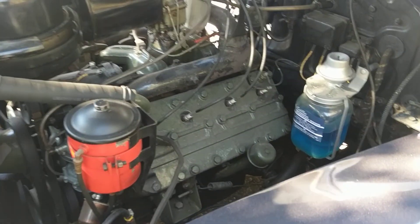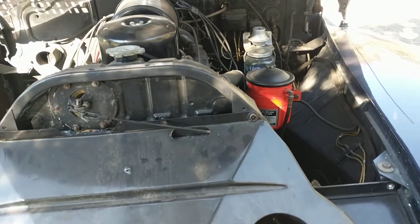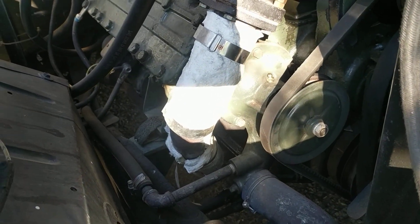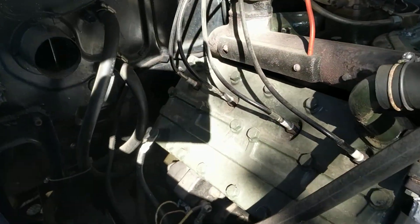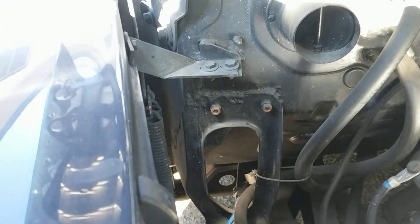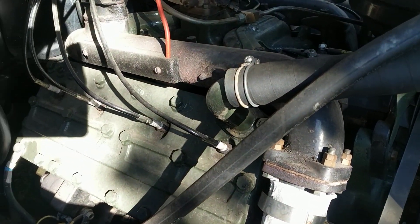These cars originally had porcelain exhaust manifolds, and you'll see some of the porcelain is still intact. There are some things right here that need attention. This originally was wrapped with an asbestos material covering to keep the heat away from the water pump, which is right there. I can see that the routing of these cables is not original. The battery is an Optima down there, and somebody has stuffed a bunch of rags alongside it to keep it from rattling around. There are heater hoses wound around all over the place that look pretty ugly. Just cosmetic stuff — things that can be cleaned up and things that should have been done right the first time.